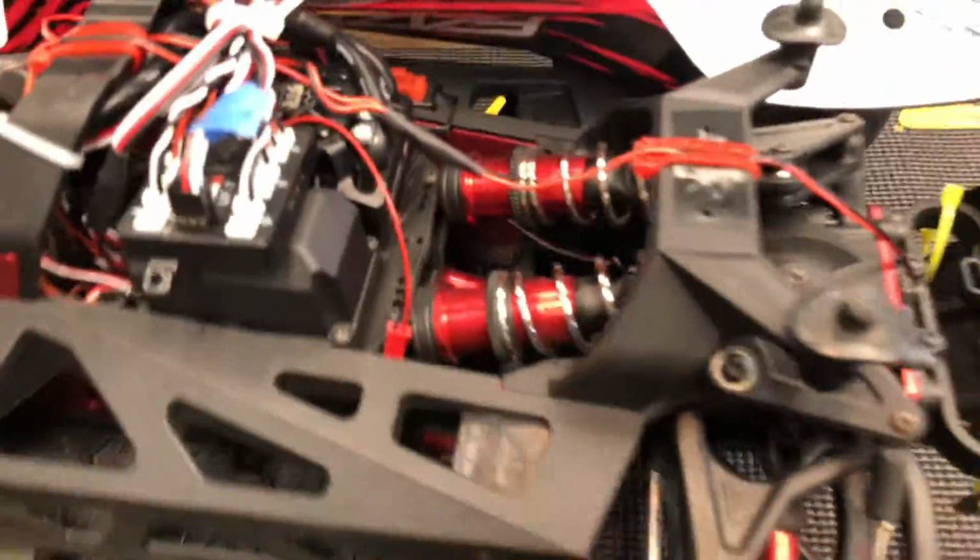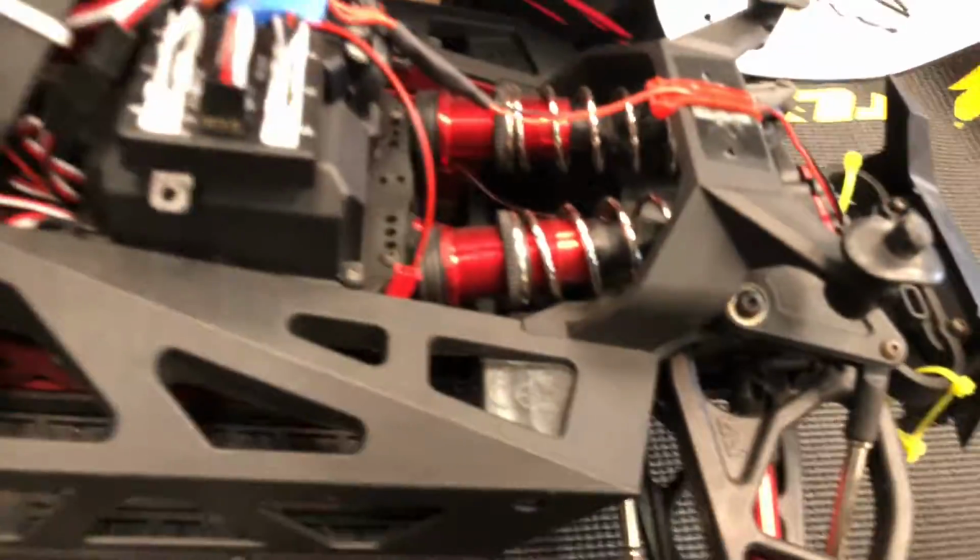A lot of the times, the servo motors, you can see one in there, for the differentials, the wires will actually come out of their little plastic housings. They're really cheap, little clipped in, and they get shredded up by the clutch system in there, the gears. I've had that happen before. It was only like a $20 fix, and it took me an hour to fix at the time. That was my first time doing it. So not a huge issue, but still, something to watch out for.